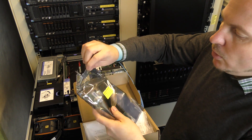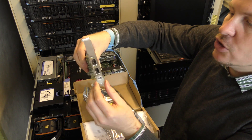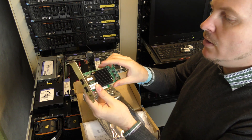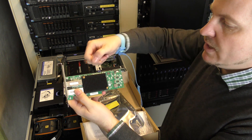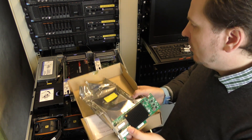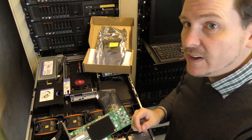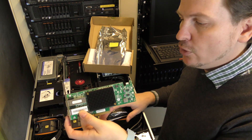This is the normal way to put in a 10G card. This is a 2-port 10G card, which means you can run two 10G connections off of it — a combined 20 gigabit connection. This one is an Emulex branded card. With these servers you can get different brands of network cards — there's Qlogic, Emulex — but different cards from different manufacturers are approved for the Lenovo servers.